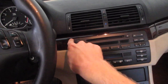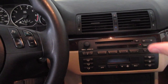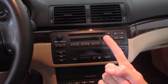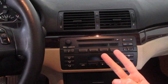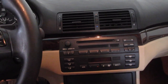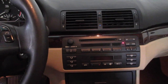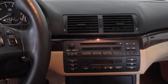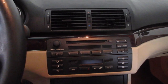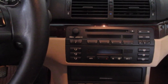Start on this side, then work over here and pull it out. You'll see two Phillips screws — loosen them and remove the radio. You'll see a sticker with a part number and a build date. Type your part number in Google followed by 'Sirius' and read some forums to see if that part number supports Sirius XM. You can also go to eBay — if they're advertising it's Sirius, you're good to go.